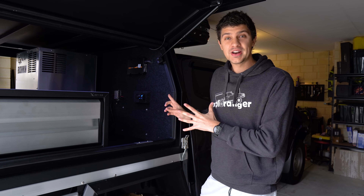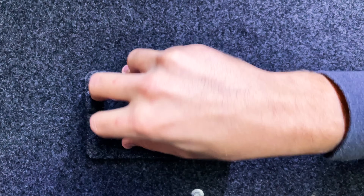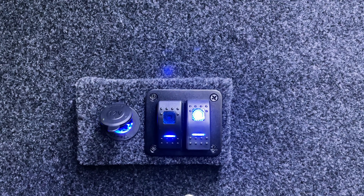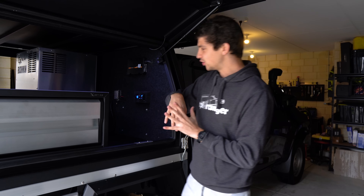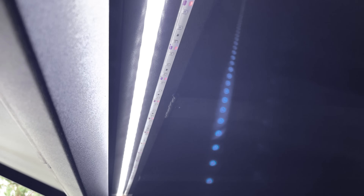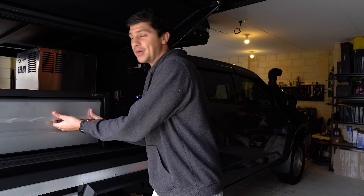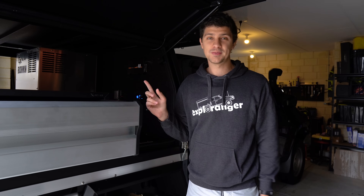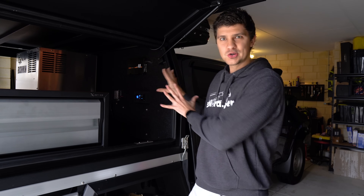The last piece on the driver's side of the canopy is this little control box I've made up. It houses a 12-volt outlet and two switches. I've run nice thick cabling to that 12-volt outlet, so if we ever wanted to run a dedicated freezer on this side of the canopy there's enough room and that socket will provide more than enough power. The outside switch runs the white lighting inside the canopy, and the second switch runs the amber lighting. That way, if you're camping somewhere with a lot of insects, you can just use the amber lighting and not be bombarded by bugs.